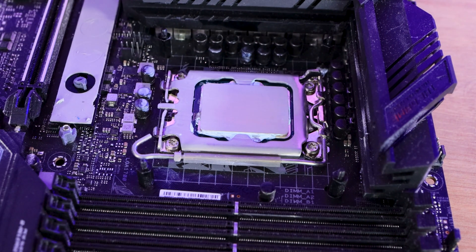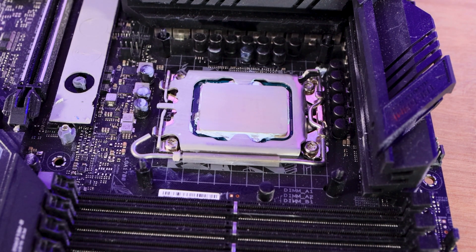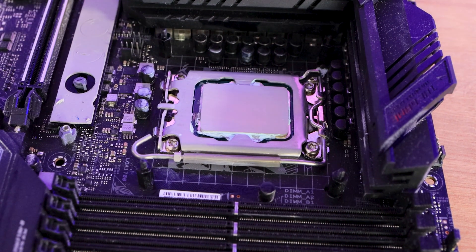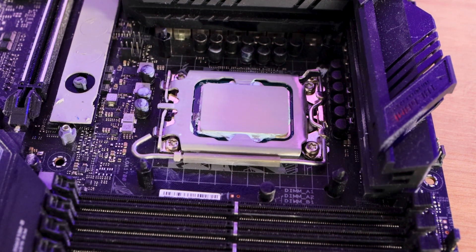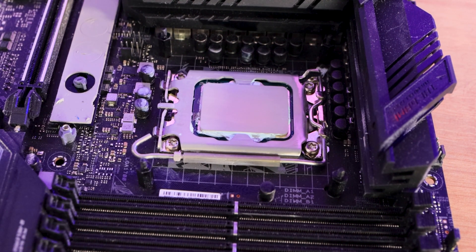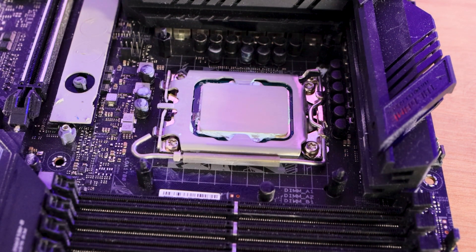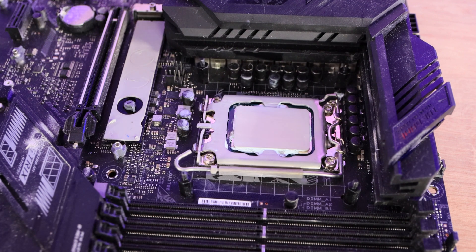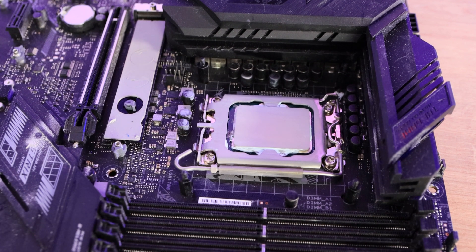You may ask why you should clean the CPU and put fresh paste on. Thermal paste can dry out over time, especially if you've got a hot CPU, it's not well looked after, or it's just been a long time. Dried-out paste doesn't make good contact with the cooler, which causes your CPU to run even hotter. Cleaning it off and getting some new thermal paste on will do wonders. There are lots of thermal pastes out there — any is better than none — but consistently good ones usually come from Arctic, though we've reviewed others in the past.